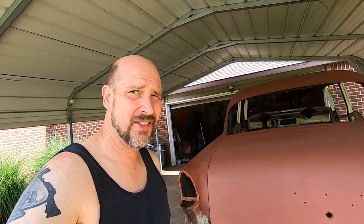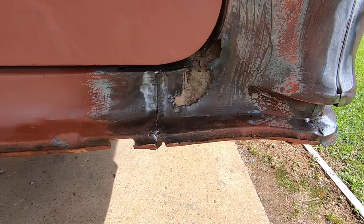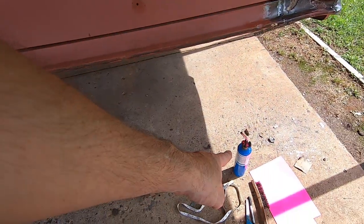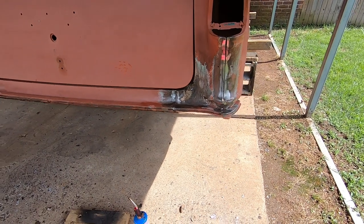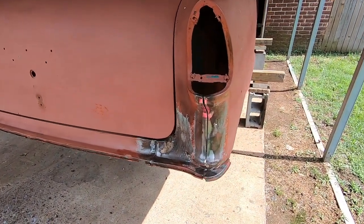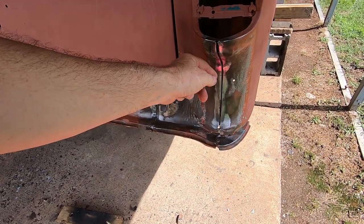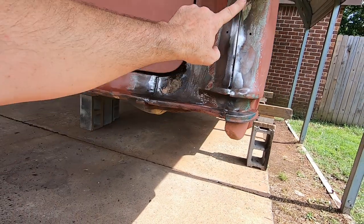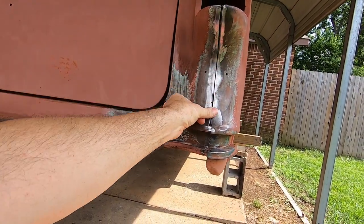Here is the bad — viewer discretion is advised. I knew this had body filler back here. So I ended up heating it up — I used a propane torch and a wire brush. I had goggles on, a long sleeve shirt, welding gloves and all that. I melted all the lead out and knocked it all out of there. What I like to do is go through here and tack all this up until it's fully welded and then grind it — that way you don't have any lead issues.